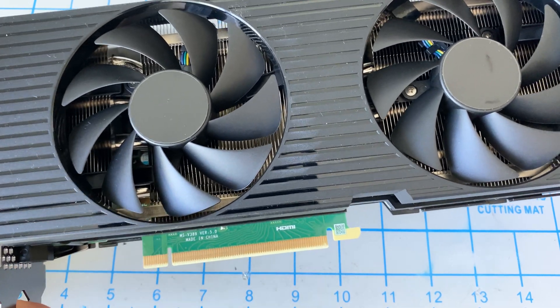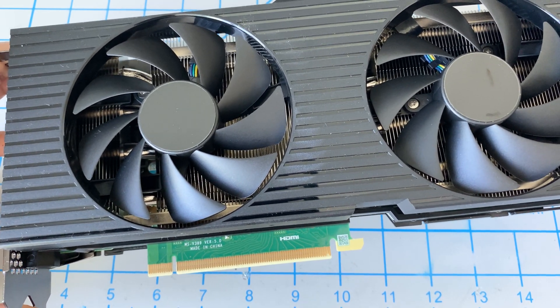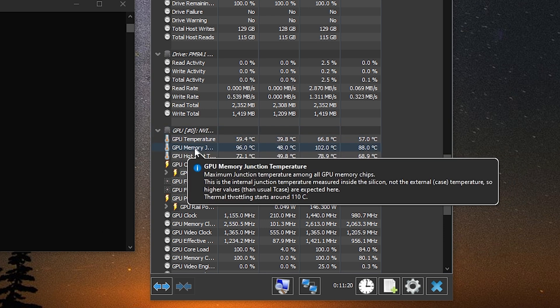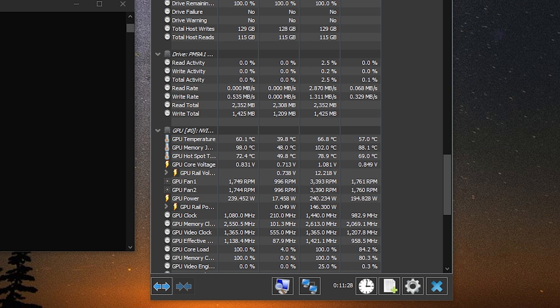We're all done — let's reinstall this back in the computer, following the same steps in reverse, and we'll see how well we made out. We've got the computer put back together and the fact that it turned on is already a big victory. I've got a mining activity happening to put some stress on the graphics card. We can see the temperatures are well within reason — our main chip is at 60 degrees, and more importantly our memory chips are at 96. Previously it would automatically go right to 110, and once it hits 110 it starts to slow down because that's the upper limit. Our fans are not even at maximum speed yet, so this is a huge victory.